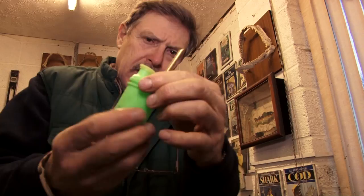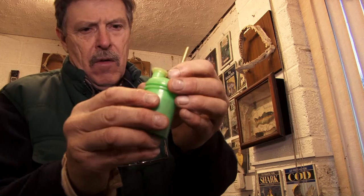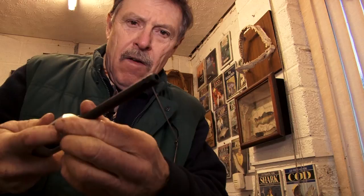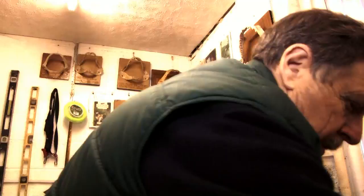Turn that round and zoom in — you should be able to see I'm just over one on the pressure. Up to two would be about the average burn. I'm going to get it up to one and a half — that's enough. Then we fill that little reservoir at the base with methylated spirits using the little dispenser — it's got a nice brass tube so you can reach in and just fill that reservoir up. Methylated spirits evaporates really quickly, obviously it burns usually with a sort of purple flame. Then I recommend these little auto lighters which have a safety lock — you can't make any mistakes, it won't spark until you unlock the safety.